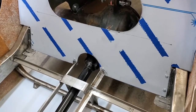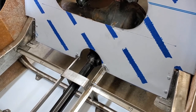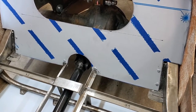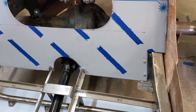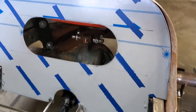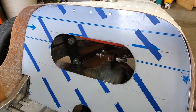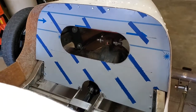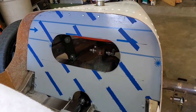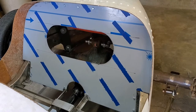It's held in place with a handful of bolts: two attaching the passenger's lower corner, one on either side of the drive shaft — mostly to keep the panel from flexing, which would have made a sound like the Flubbermobile, which is cool but only if you're driving a Model T — and two more on the lower driver's corner. The panel was trimmed a little narrow along the frame sides to allow room for the welded-on brackets. Up top there's a row of bolts that attach the boat tail to the bulkhead panel itself. There was quite a bit of time spent trimming the panel to shape, with a tight gap around the body — trim and fit, trim and fit, until it just snicked in there real clean.